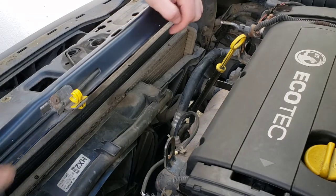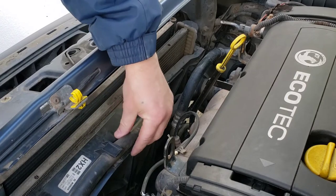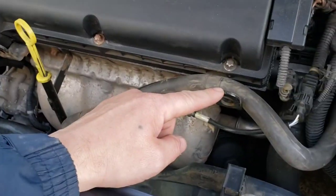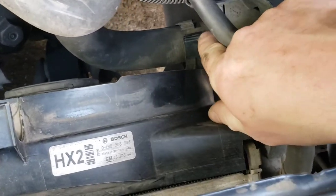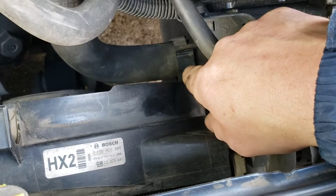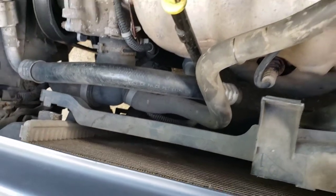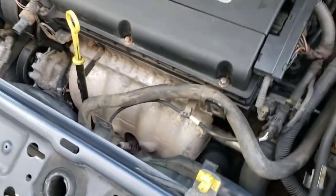Now all you have to do — you will have this pipe just here running around which connects to the plastic cooling shroud. I'll just pull that out like that, and this one, and I'll just hook it over that part just there. The next pipe we're going to be removing is this one here — it's on a clip, you just lift the clip up and it releases, then you just pull your pipe out. You must do that just so you can free that up. There ain't no screws on the bottom, they just hold it in by a clip.